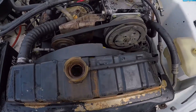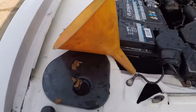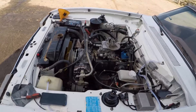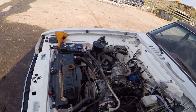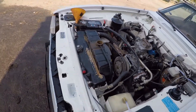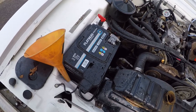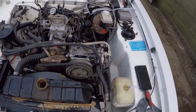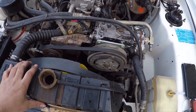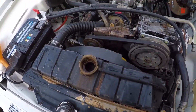As you can see what a mess here at the minute — I've just been flushing the cooling system again. It's had an additive in it for the last few weeks to help clean it, and I keep getting more and more crap out of it. I think I've got most of it now but there's still all this sludge. It's either from a previous head gasket issue, a current small head gasket issue — it did seem like there was some kind of sealant already in the system — or it could be where someone's mixed antifreezes over time, like blue and pink, which aren't compatible and turn into sludge. It's a very odd sludge, gooey and slimy, kind of oily but not the usual mayonnaise you'd get when you mix oil and water. It's just been sitting at the bottom of the radiator. The only way I've got it out is by running the engine up to temperature and then pumping water down into the radiator to have it overflowing — and this is what's come out.